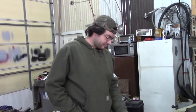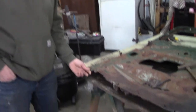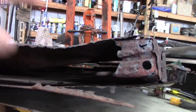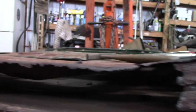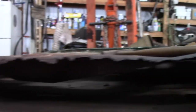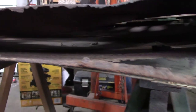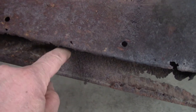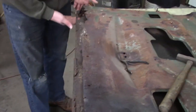Connor showed up at the barn and he's got some ideas on the door. It's got a curve on the outer skin, and then there's also a crease going here. How I would make it is an L-bend piece that goes here — the outside skin's actually going to attach to it. From the outer skin, you'd L it back and come up. Then you can work how the outside skin is going to be curved pretty easily with the shrinker stretcher.